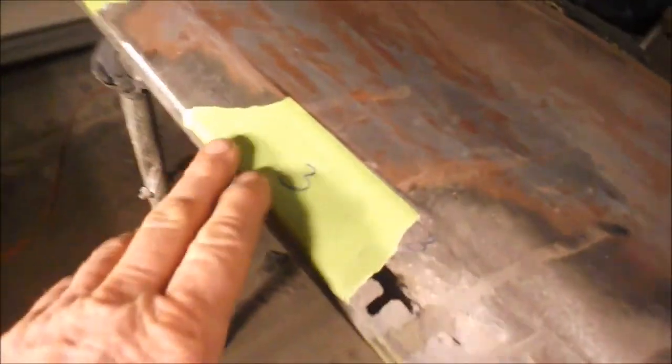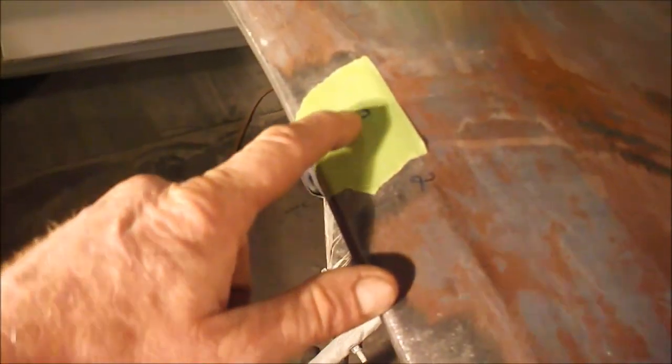All right, got some catching up to do. Got everything stripped down. Got some holes. There were small rust holes. These two were actually nicks in the paint, and they eventually rusted through. So they're really small. They weren't rusted from the inside out, in other words, which ends up making a little rust hole really big. So I've got one on each corner like this, and these are a little bit bigger. I'm trying to keep them as small as possible.